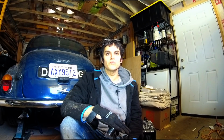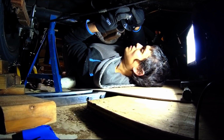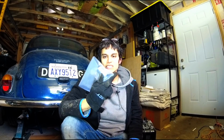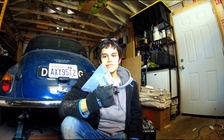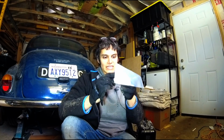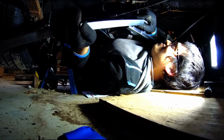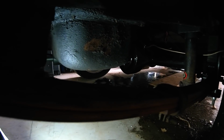So I guess it doesn't really come as any kind of surprise, despite me checking the thickness and they seem to be pretty much the same. It was a difficult measurement given the lack of equipment. So I chose instead to not replace the crush washer, because if this doesn't work, then I may well have to do that later. And I still have a replacement seal here, just in case I need that. Basically got it about as tight as I can and thread locked it on, which may or may not be tight enough. We may find that I destroy this differential, which will be very upsetting, but I can order a new one if I have to.